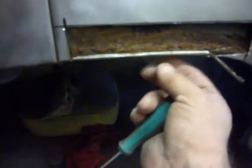Might leave that piece there, do it the lazy way. I'll just find the spot welds along the bottom. Sorry, not looking at what I'm doing. Find the spot welds along the bottom and wrap the bottom, but just bring it into there and weld it in. Got to weld that up now. I've cut into it, but at least I know it's fresh metal. It's pretty solid, very solid from the back, so I think quite a pointy screwdriver. It's pretty solid. So clean up, treat, all that good stuff.